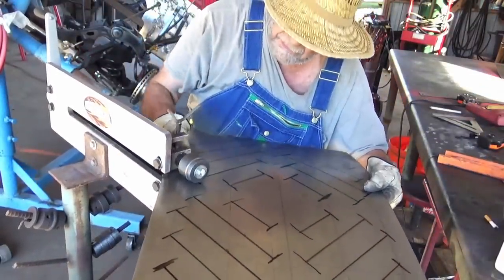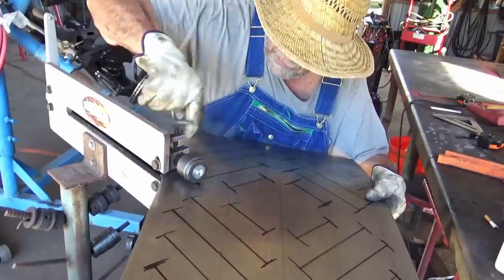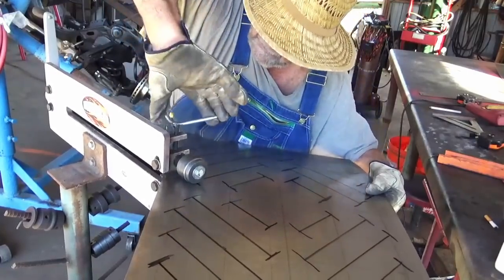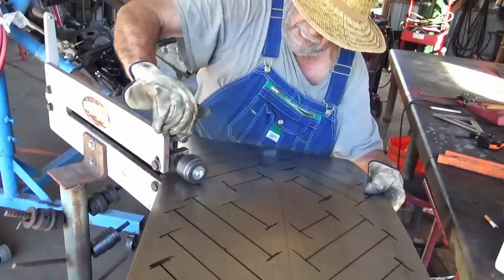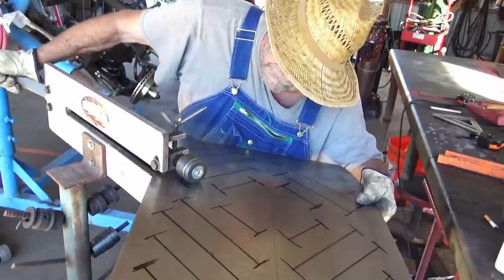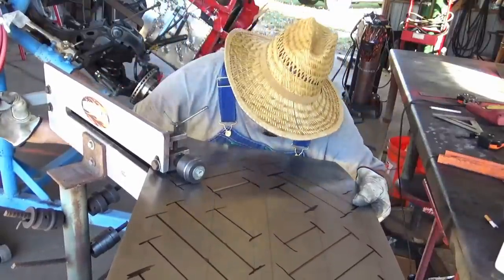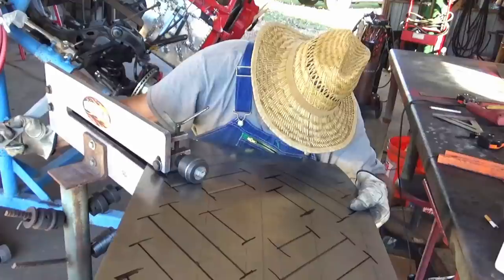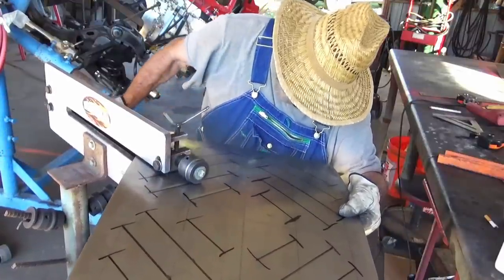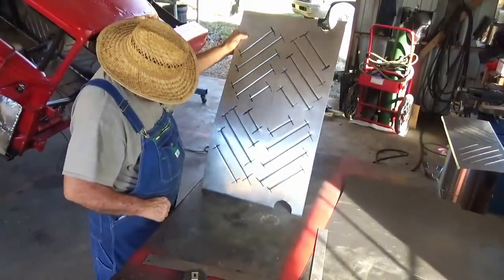That's one bead. Now I get over to the other one, get the end point lined up, get it lined up centered. Go by the same depth. If you start a little bit off the land, it's better to just stay off that same amount all the way down, so you won't have any curves in that bead. But this is going to get painted.